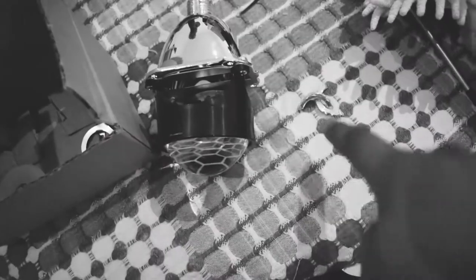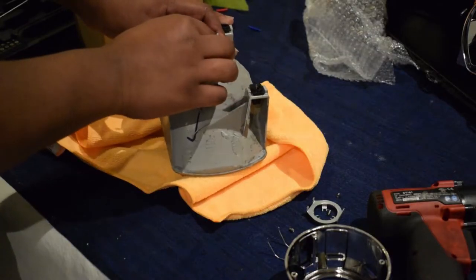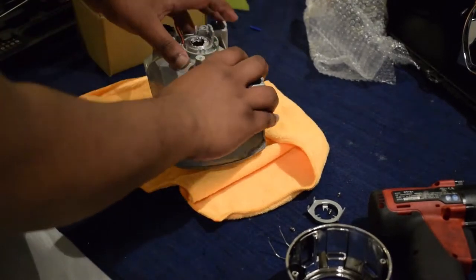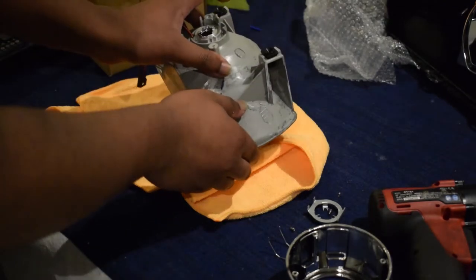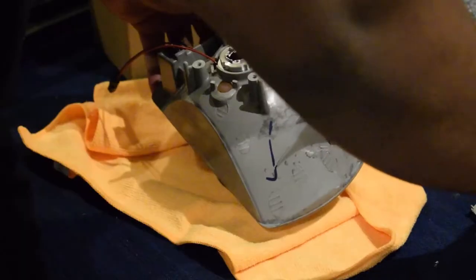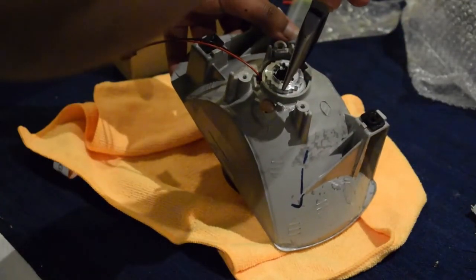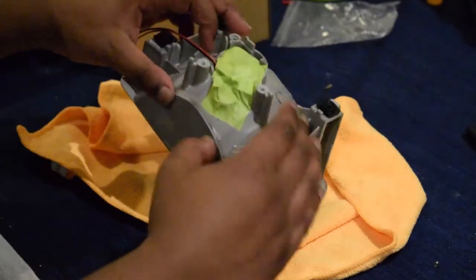This lock ring is really soft and can get damaged easily - it stripped and I learned that the hard way, having to order an entirely new set of projectors because of that. What you do is just lightly finger tighten it down so that it sits and you can still make adjustments. When you're happy that everything lines up you can go ahead, use your pliers and twist it down fairly tight.